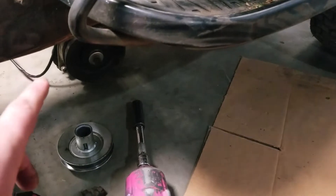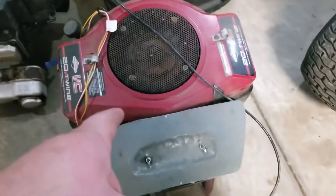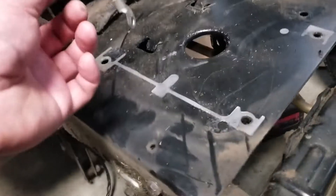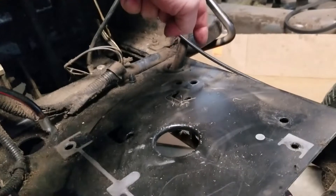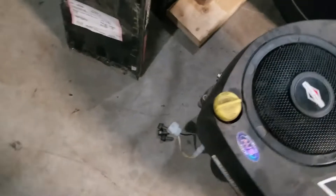So use the same crank pulleys and bolts that stay with this mower - the ones that came off the old engine stay with that mower. And then, you may have to keep an eye out for which side the electrical is on. For example, the other engine had the starter on this side, but the new red engine has the starter over here. It depends on the engine. The original engine for this mower was a Briggs & Stratton V-Twin. This engine bolted right up, no problem - same style electrical connection, starter on same side.